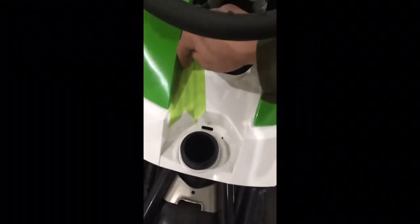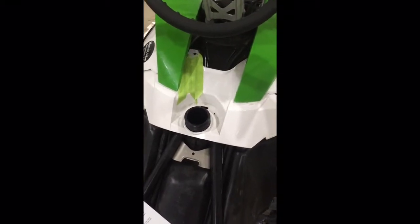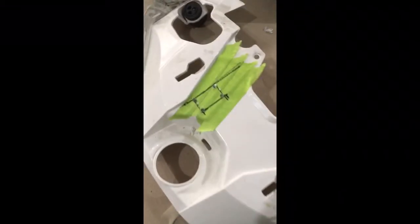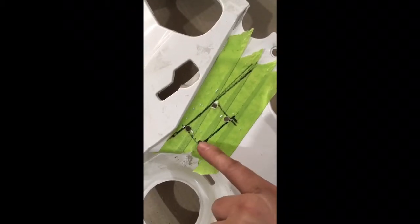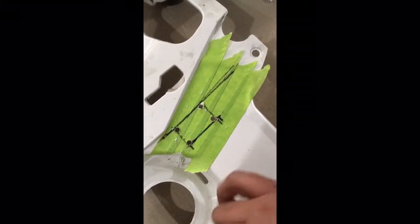Because I didn't have a template, what I've done is put the hood back on and applied masking tape in the area where the switch needs to go so I can mark the edge. You don't want the switch where you can't get at it — but I need to keep it away from this structure here; there are bars that come down, so there's basically just one small spot it can go. I got my panel carefully marked — I measured three times, hoping to cut only once. I really don't want to screw this up. I've taken a small drill bit and drilled it in the corners, and my plan is to take one of my little saws and connect the dots. I've actually marked the hole a little bit small, hoping I can file it out as needed.